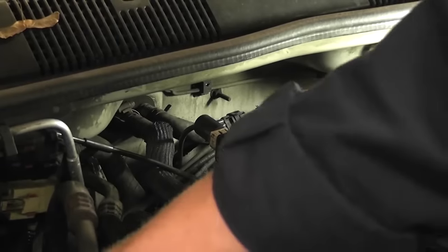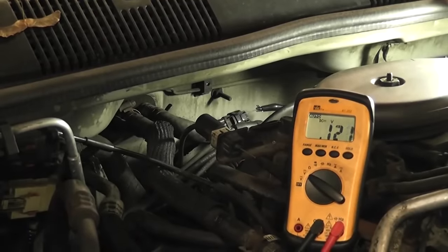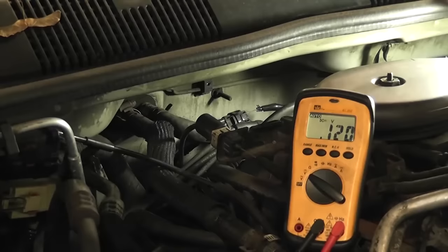If you were doing something like this and you had a no start with a crank sensor trouble code, the procedures I just showed with this voltmeter, you would follow. Check your power, check your ground — you need to know what your power feed is. Check your ground, check your signal. To see full amplitude of a signal that's on-off — a very fast signal with an average reading voltmeter — you need to slow the crankshaft down. That's what we did by bumping the key. We got those windows on that flywheel to be in different positions, trying to catch the signal with one of those blades in between. We were able to catch it — that would be a good crank sensor signal.